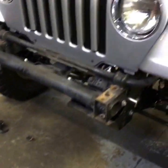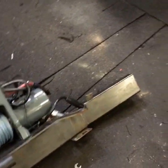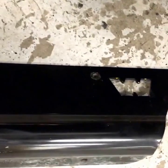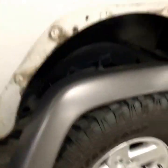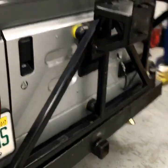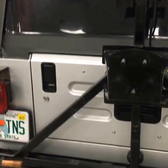On this job, we're going to do a bunch of the accessories on this Jeep. We're going to rhino the whole winch bumper and make it solid. We've got the fenders loose on it — all these fenders are going to get prepped and sprayed out with rhino lining. The rock guards for the side are going to get completely sprayed with rhino lining also. That's what it looks like with all this stuff off the vehicle, in case you ever wondered.